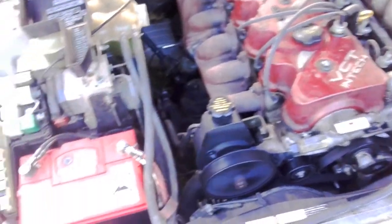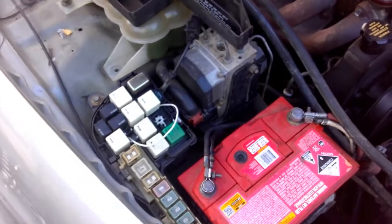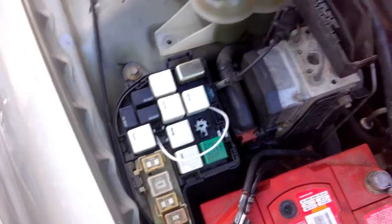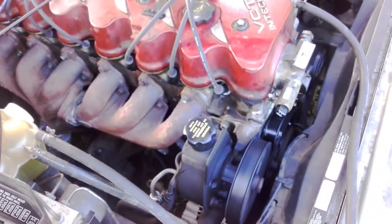This is a little trick that I do with all my Falcons. I want them to run a bit cooler, so I do a jumper between those two relays there. What that allows the engine to do is trigger the high speed fan when it gets to 74 degrees.